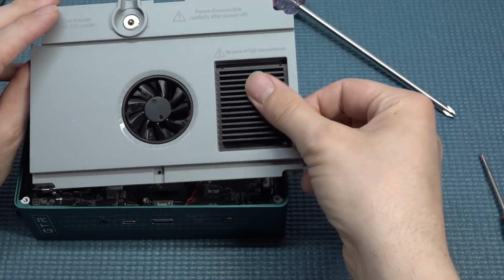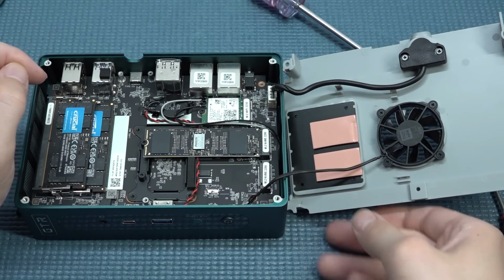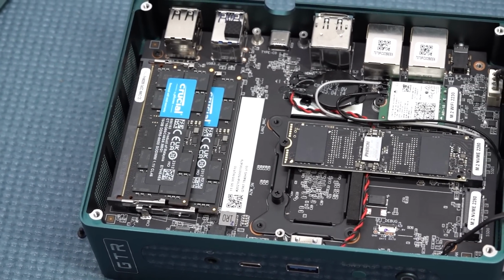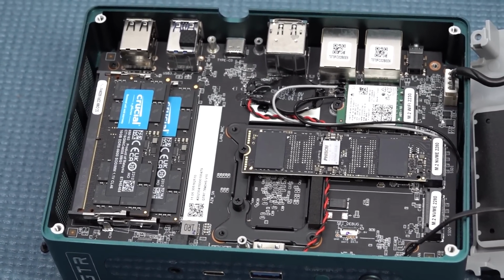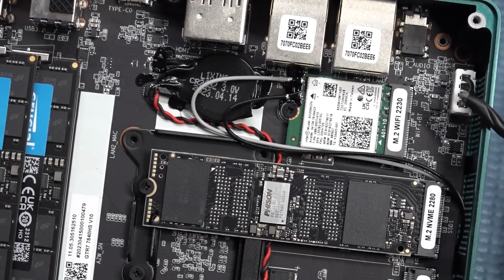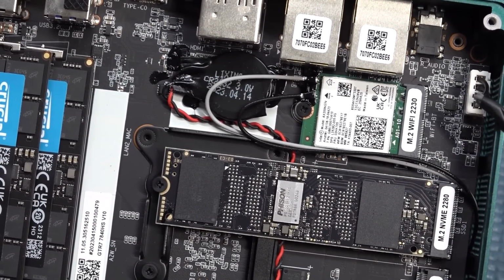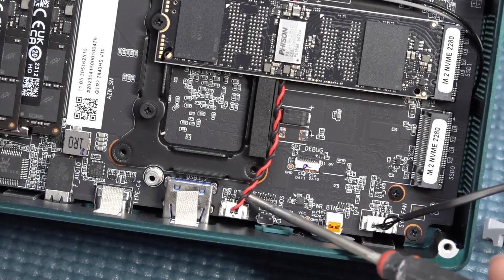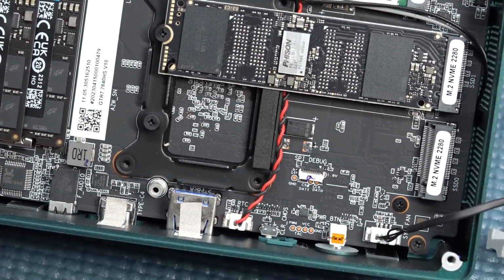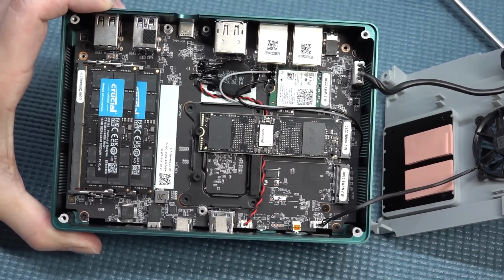The way everything is constructed, including the cooling for the NVMe's, is absolutely great. Everything is in place for the second one that I want to implement later on. Dual channel memory, so if you need to swap it out, you can do that fairly easily. And the same goes for the storage capacity. If the mainboard battery dies off, you can fairly easily swap it out, and it also includes the Wi-Fi unit. Everything has been assembled in a certain way that we can do maintenance fairly easily, which I've seen before was quite difficult with some of the mini PCs.